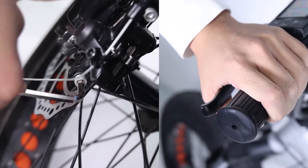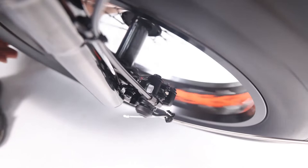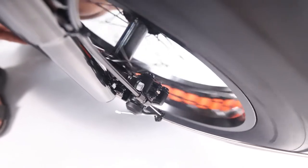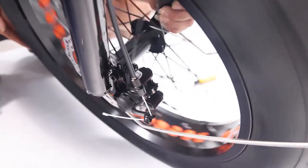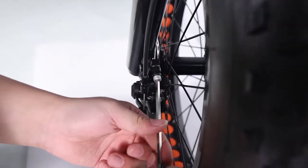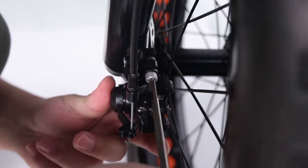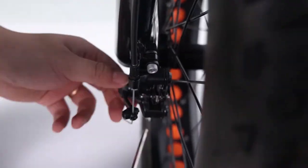While holding the lever, tighten the bolts. Release the brake lever, spin the wheel, and check for pad rub. If there is no rubbing, the pads are aligned. Secure the mounting bolts to full torque and your work is complete. If the pads are still rubbing, we need to do some fine tuning. Loosen one bolt at a time and adjust until there is a gap on either side of the rotor. Once the pads are not rubbing, fully secure each mounting bolt and the process is complete.